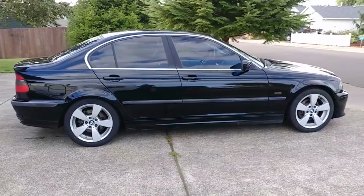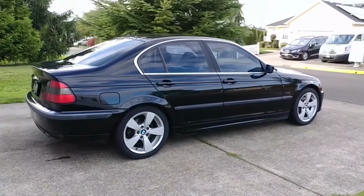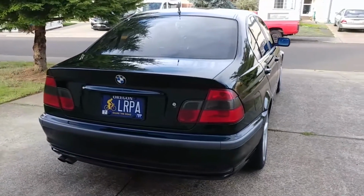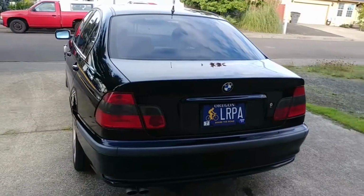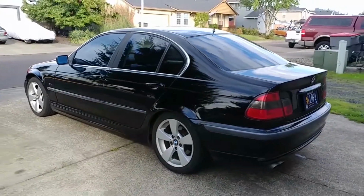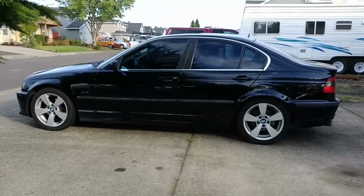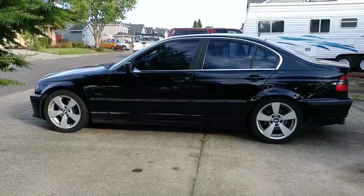A lot of people in the BMW community, including myself, agree that this fluid should be changed every 25,000 miles, but this is based off of personal experiences. I'll send a sample in for analysis on my next fluid change. In my experience, my shifts always start feeling rough right around the 25,000 mile mark, so I've been going with that interval for about 7 years now. This time it's a bit overdue at 29,000 miles since my last fluid change, and the clunky feeling is really getting annoying, but work and school come before BMW and YouTube, unfortunately.